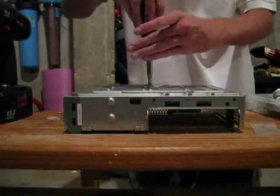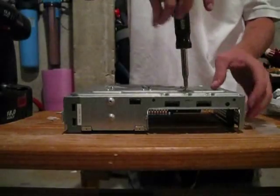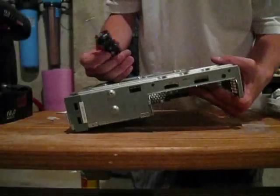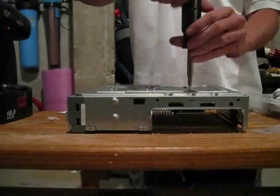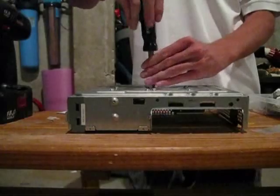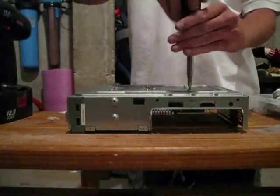I like to go back and forth. You're not going to want to tighten one screw all the way, because that will set things off the line. You can tighten the two across from each other, as long as the heat sink is coming down level.